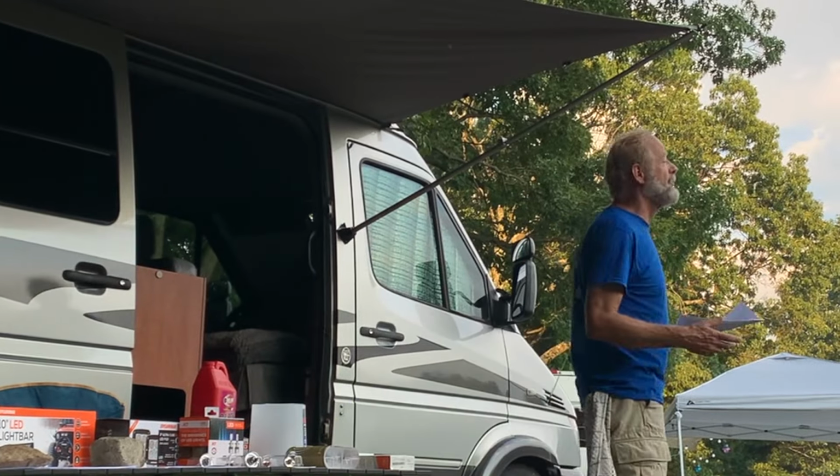So one tablespoon on a rag, wipe a little bit, and that's it. That's something you can do every month or every 6 weeks when it gets dirty again, and it will give you a measurable improvement. Not as good as this, which will actually get you to over 90% of your original light output. So, obviously another solution is you can replace your headlamps.